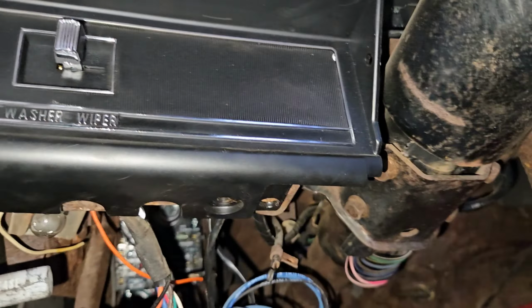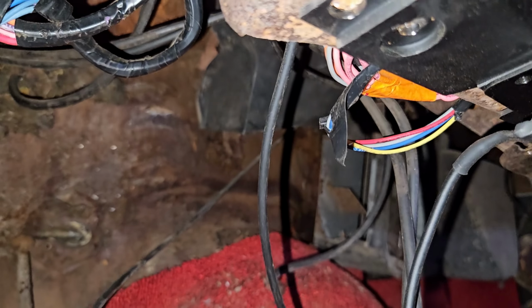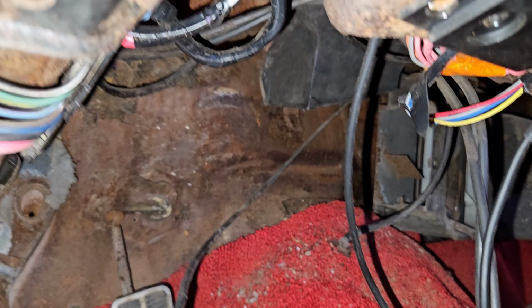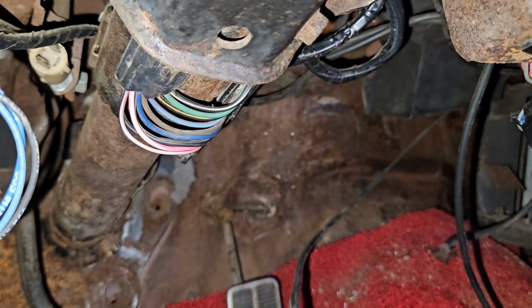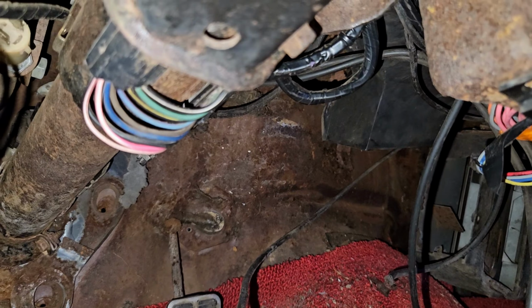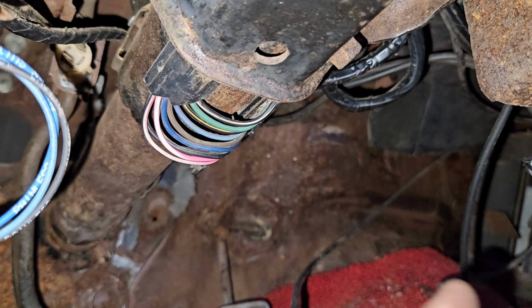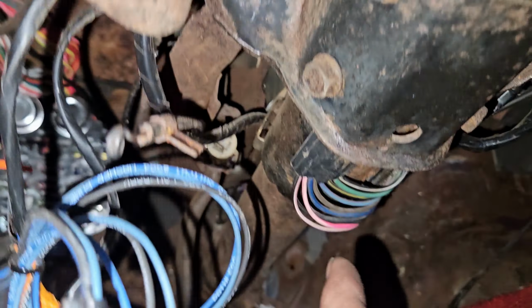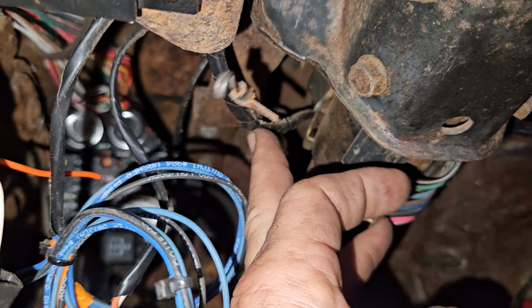I did find, obviously, the heater box and stuff. I'm going to talk to him about taking it out and building the panel, because this is a car that you would want AC in to be able to drive in the summer, and you're not going to get AC with that. And the heater core is actually cut off at the firewall, so it's basically just blowing hot engine air through the heater box. I'll show you in a second. But I also found the brake switch is not hooked up, so he has no brake lights.